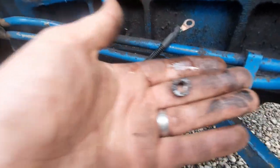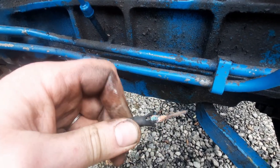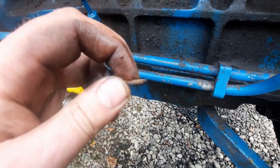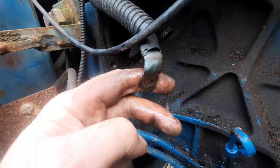This will tell you just how hot those connections got — that is the tin finish of that lug. This was a tinned, tin-covered copper lug and it's actually melted the tin off it. Similarly it's damaged this one, and this is pretty well cooked as well. So let's get it on the bench.